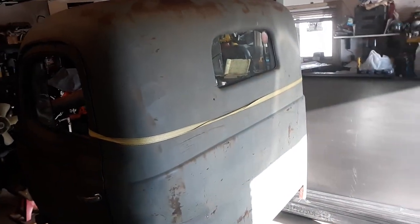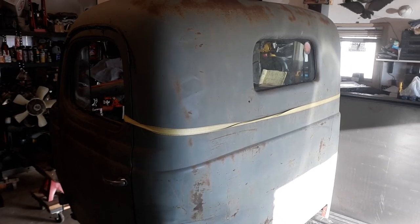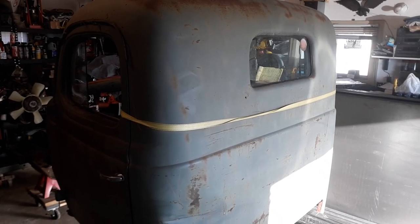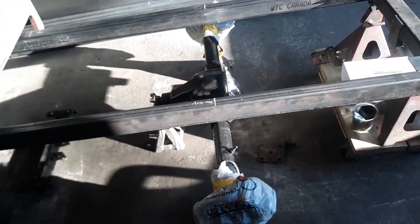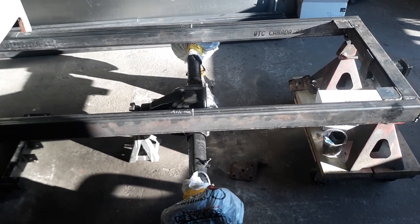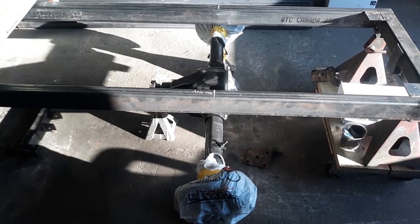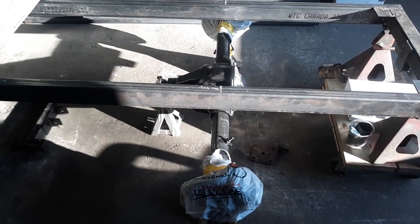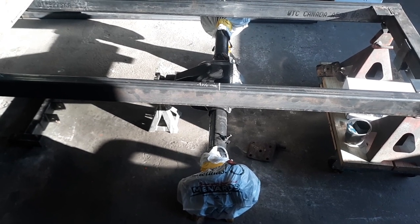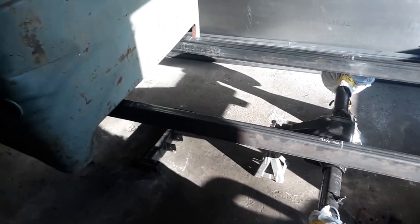But what I'm going to do is I'm going to put AC in it. Heat, 5.7 Hemi, 727 TorqueFlite. I'm thinking, though, I might rebuild an A518 overdrive because the problem is I got 410s in the back here. So we might have to go with overdrive yet. That 727 might have to go up for sale. And it's all rebuilt, you know. It's probably got maybe, I don't know, 3,000 miles on it maybe. It's the long shaft 727. But anyway,